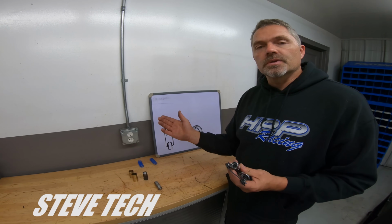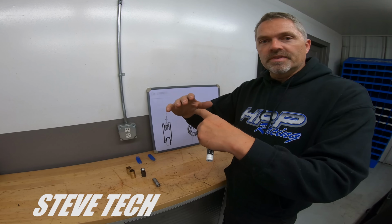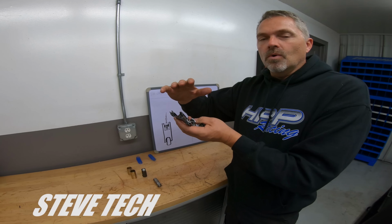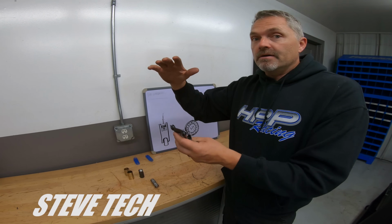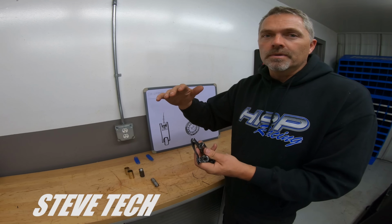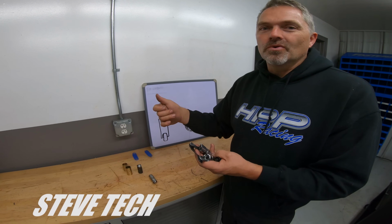You just want to make sure that it's not being hung open when the motor's cold. Remember, motor's cold, everything shrinks. The block and head actually shrinks a little bit more because of the mass than what the valve train shrinks. So sometimes it would hold the valve open when it's stone cold. Valves are open when it's cold, thing doesn't start. No compression.